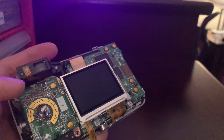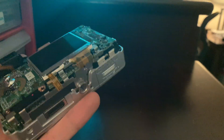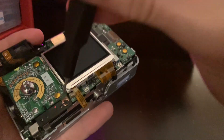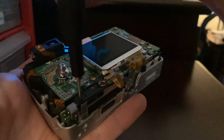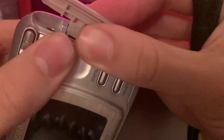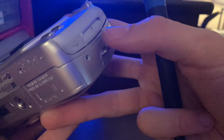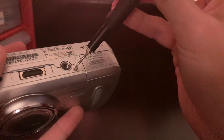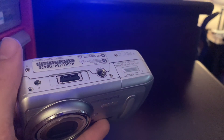There are two screws on the bottom of that and we're pretty much good. That whole metal plate on the bottom should just come right off if you unscrew that one screw. Make sure the spring for the little door is underneath the back cover — there's the front cover and the back cover, and when you take it off, make sure the spring is behind the back cover so that it springs right open for the little door that holds the SD card. Screwing all the screws back in — there are four on the bottom, two on the left side, and one on the right side — which hold the front and back pieces together.